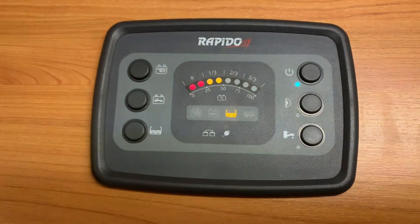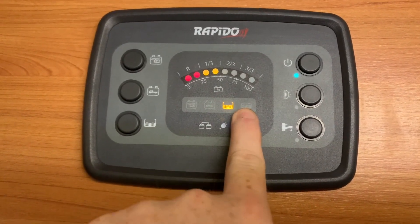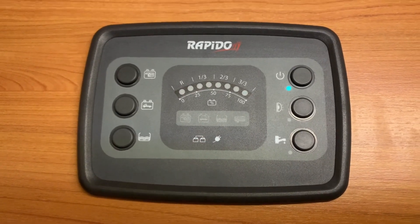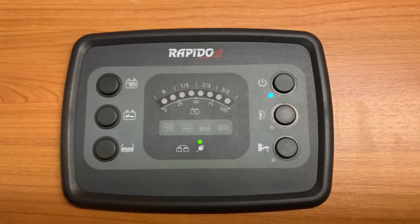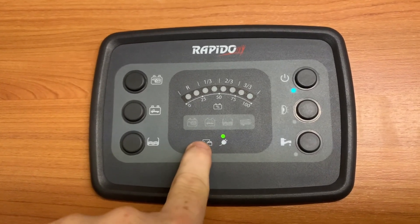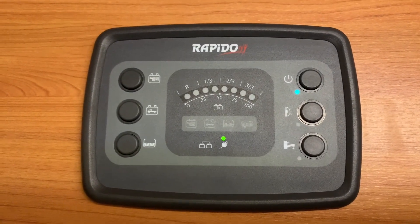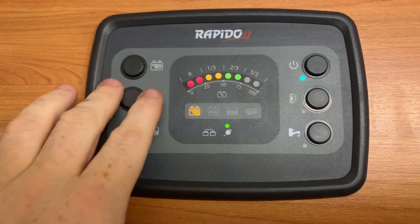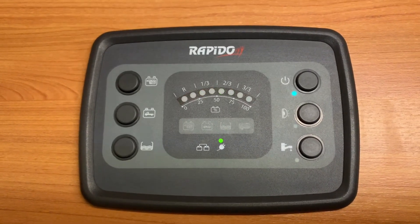Very easy to understand what you're looking at there. If this symbol comes up here, that shows that your waste tank needs emptying. If you're plugged into mains electric, you'll also see this illuminated right there. So here we go — we're now looking at the control panel with us plugged into mains electric. There is that LED light on. Another LED can illuminate here if your electrical system is wired to charge both batteries at the same time. And now you can see we have charging voltage reflected in the leisure battery there, so that's come up a little bit as a result. That's what it looks like when you're plugged into mains electricity.